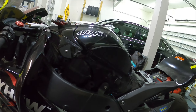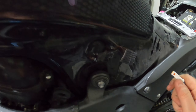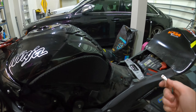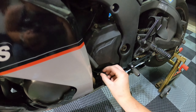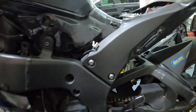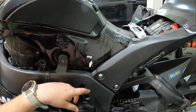I've actually ended up taking that side fairing off just so I could see a little bit better what was happening. It doesn't look like I'll be able to fit this connector down next to the tank, so what that means I'm going to have to do is lift the tank up a little bit — not hard, but just going to have to do that. Basically I'm going to route it along the outside of my sprocket cover. I just picked the tank up a little bit to get some clearance and then pulled the two pins up. Now I'm just going to do some finishing touches and connect these up.